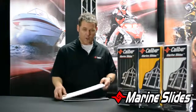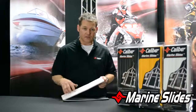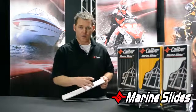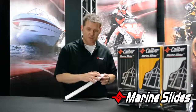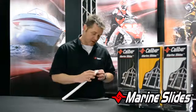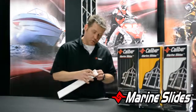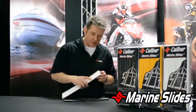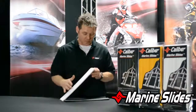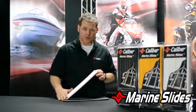When fastening, you want to fasten these into a solid piece of wood. Make sure you check your bunks for any rotten wood underneath, and screw these down so they stay mounted nice and tight and flush to the bunk. When they mount down, there's a recess here — as you can see — that stays well below the surface, so you don't have any concerns about hitting the actual screws on your marine slides.